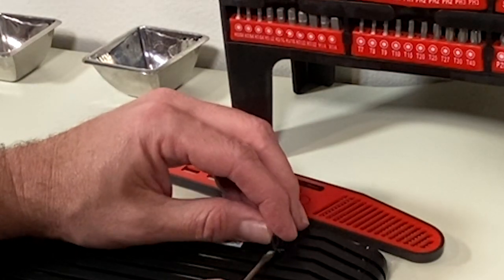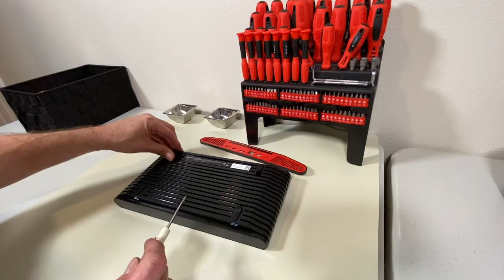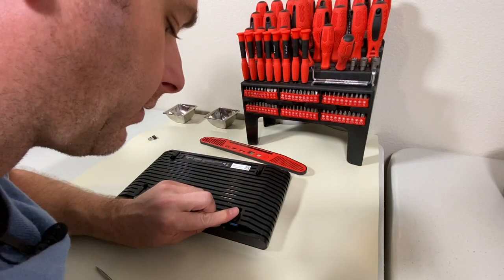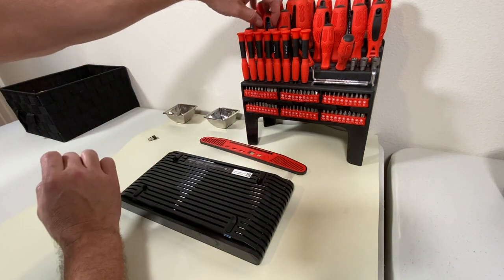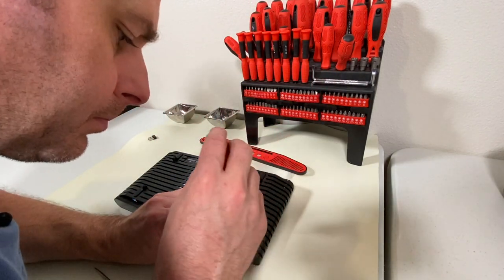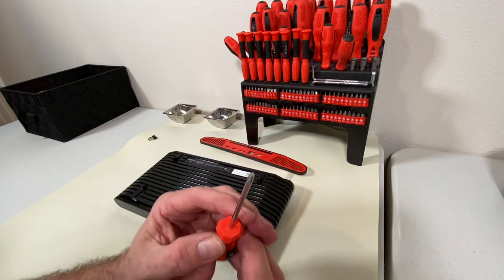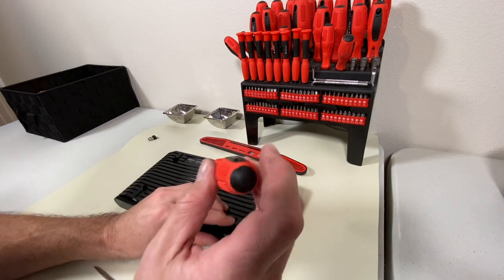It's perfectly molded — that's actually a nice design. You can see the back of it's glued, so you don't want to pull the whole thing off. It was designed to just pop right out, so that's clearly something they intended when they built this. It's a Phillips head — actually no, it's a star pattern. Let's see if I can find the right T10. It feels like it's going to be a T10. So if you're trying to crack the case open, you will need a T10 Torx screwdriver — these are called Torx screws. I'm going to go ahead and undo all four.